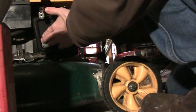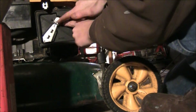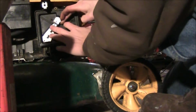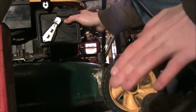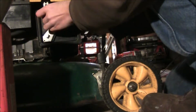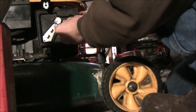So you're going to make that pop on. And another thing you want to look for is making sure it lines up with the carburetor. This piece right here is kind of blocking what you see, but those two jets that I showed earlier that are on the intake side, you want to make sure those are free of any blockage, and you want to make sure that once that is all lined up and centered perfectly, you can go ahead and screw your other pieces in. And these are 8mm pieces. Usually that works pretty good for putting this back on.